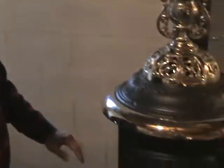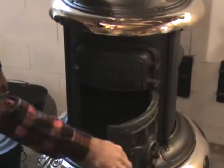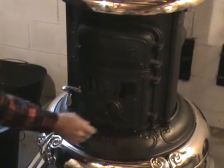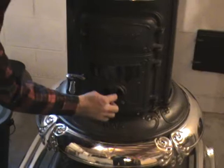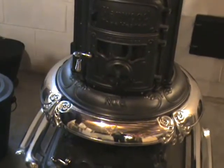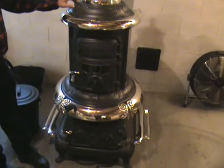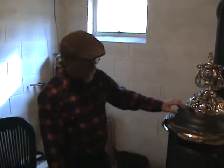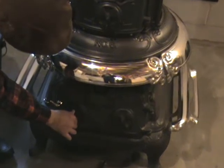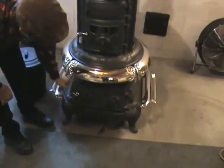If you look here, I'll show you the loading doors — it opens up and you have two doors, so you have all kinds of room in here. These doors are designed with no play in the hinges — you can't wiggle it — and when it closes, it fits tight. This is an airtight fit. The dampers are also airtight. There's a spring right here under this cap that holds these dampers tightly against the body of the door. This stove was designed to be airtight, and it is. You have complete, perfect control over the fire. The ash pit dampers are the same way — they're spring-loaded and press against the body of the door, with absolutely no leakage whatsoever. This fits tightly and there's no air leaking around the sides of the door.